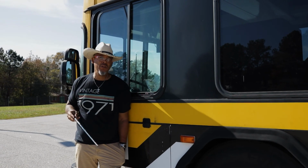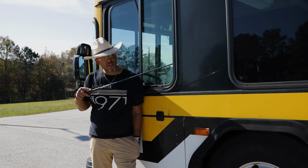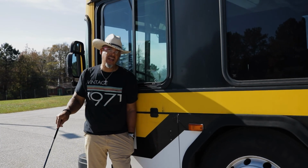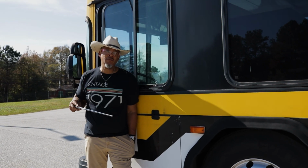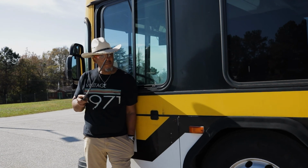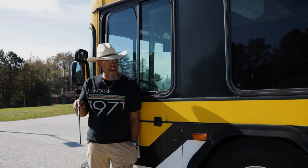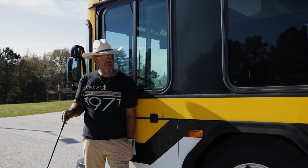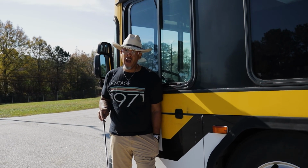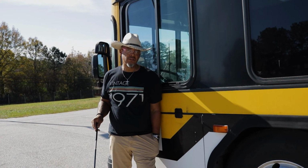Now, you need to come up with a system, however you remember. I see it because I see my steering box, the hose, the pitman arm, the drag link, the upper and lower knuckles, and I see the tie rod. But if you want to play around with that and create an acronym or something so you won't forget things, maybe you should do that. Because here at this institution, we find solutions, not excuses, all right? So there is no excuse for you to fail a test, if you're properly practicing and you have your proper systems, all right?